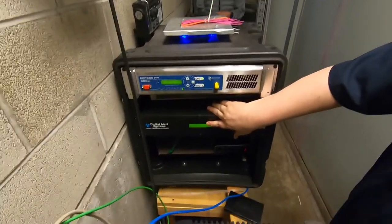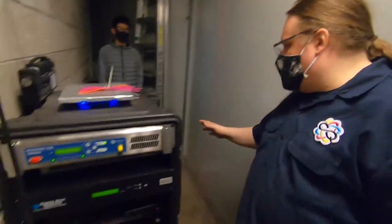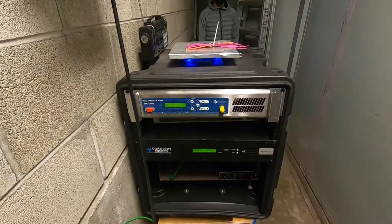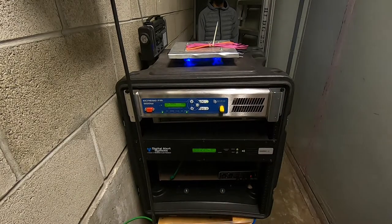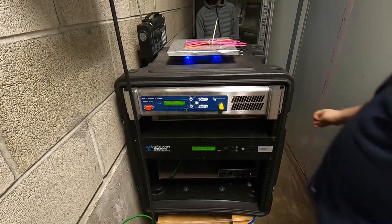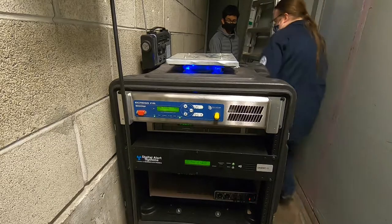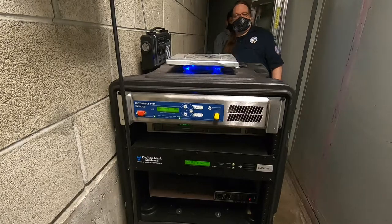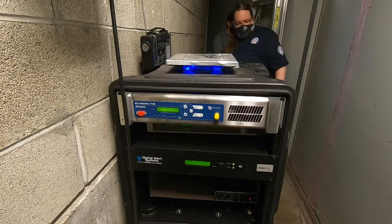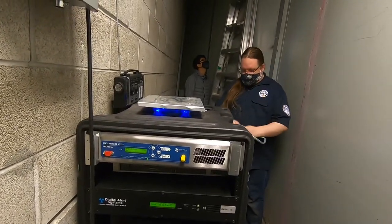Okay, if this reports a 10.140.0 IP address, that means network was configured properly. I can yank all this stuff out. 10.0.0.2. That's not what I need. Okay. 0.81.81. All right. Why did it correct with the power cycle? I plugged it into the right Ethernet port. That'll do it. It has two Ethernet ports. I don't know what the other one is for because apparently it's not for IP configuration, but whatever.